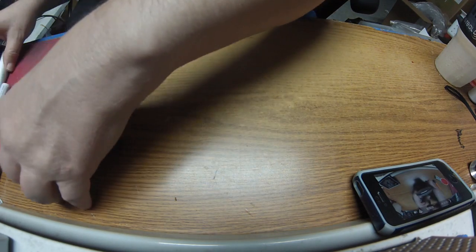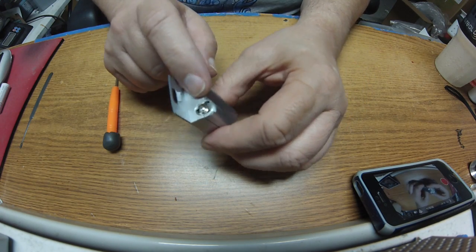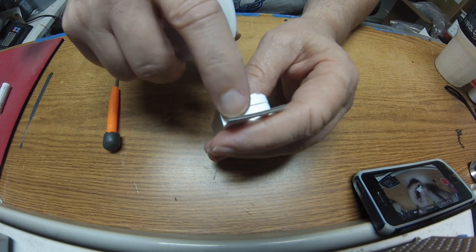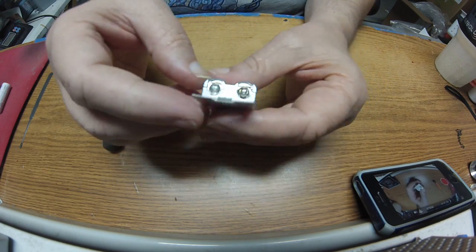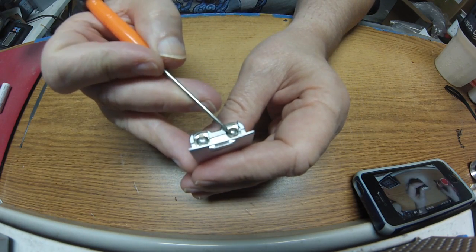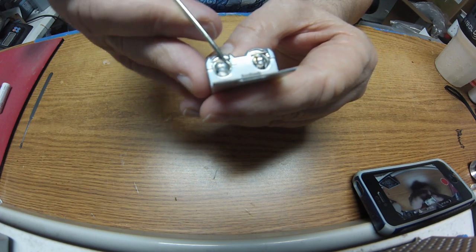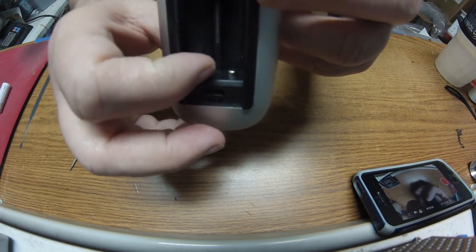This battery had a similar problem but with its connectors on this side — this is the back side. You'll notice this is the side that goes in that hole I just showed you, and it only has one pin. That's not a problem as long as you've got the other problem fixed in your mouse. This side on the other hand doesn't work, so again I've added two bits of solder right there to make these pins stick out further.